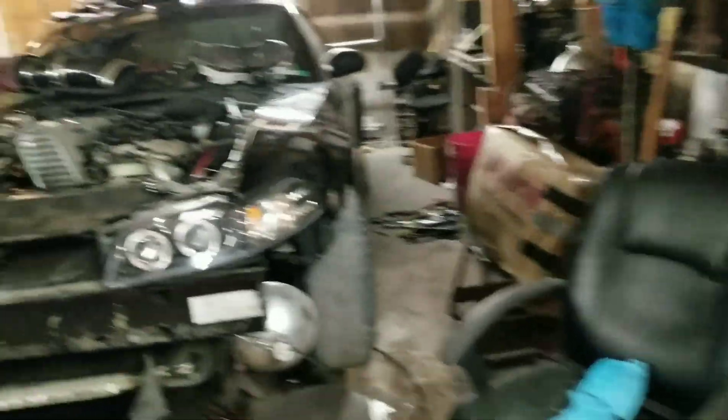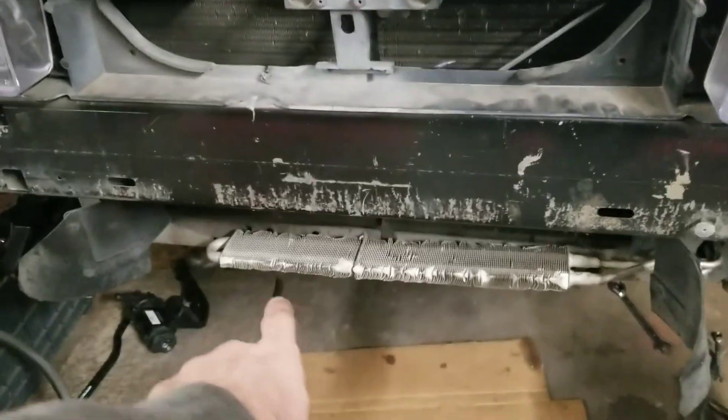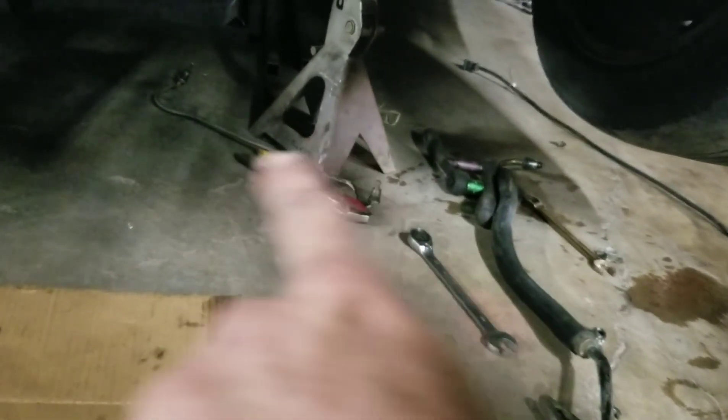We're making progress. Wrapping up a cold Tuesday evening in here — it's icy out and we're getting a bit of snow outside. Recap of the day: I've sorted through all the parts and bits for this thing, got everything laid out where it needs to be, power steering cooler installed, all my power steering lines and rack lines are basically reinstalled. Cooling lines as well, so installing the heat exchanger for the supercharger and that pump tomorrow, then rad hoses — that'll get everything sorted out there. Throttle cable and stuff like that. Shutting it down, thanks for watching.